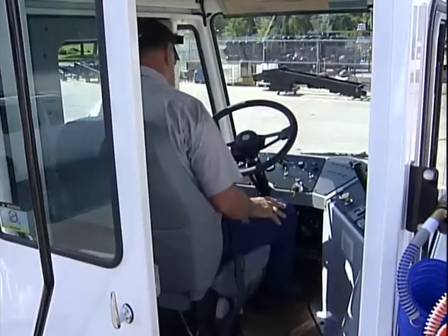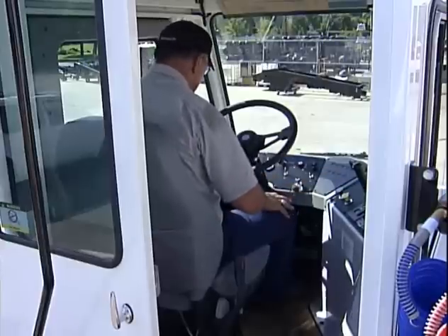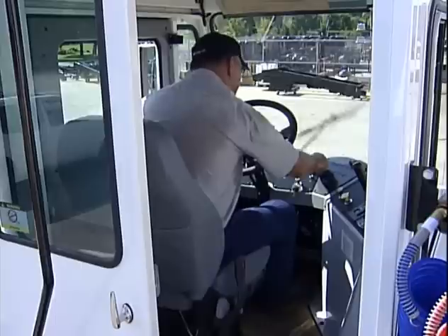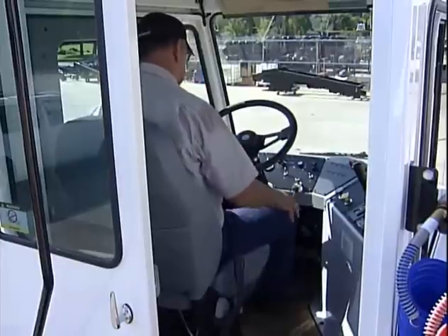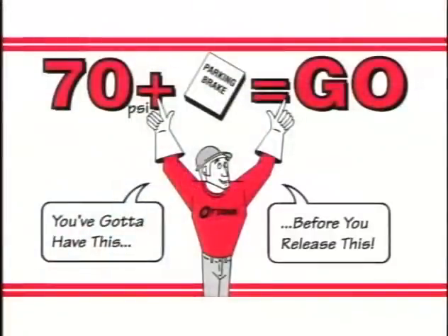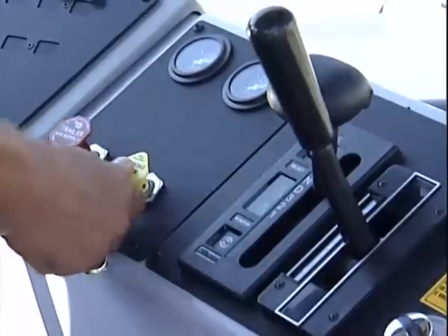After you have started the engine, let it idle at about 800 RPM for five or six minutes. While the engine is warming and building up air pressure, check your gauges, switches, and controls for proper operation. Check the turn signals, lights, and windshield wipers, and adjust and lock your seat into the most comfortable position. Your Ottawa is equipped with seat belts — fasten them. Before you can release the parking brake, the air pressure gauge must read at least 70 PSI. Apply the foot brake. The brakes are released by pushing down on the yellow button to your right. After releasing the parking brakes, move the shift lever from neutral to the appropriate drive gear and you're ready to move out.